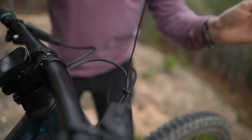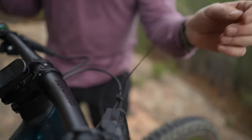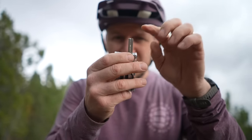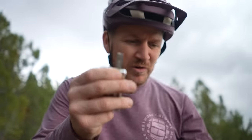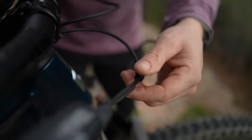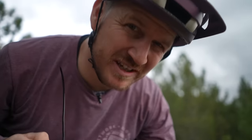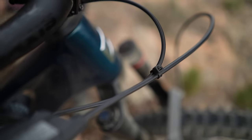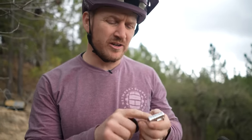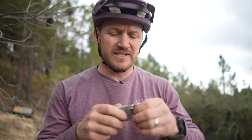But I don't like this bit right here — it's annoying. Most of us don't carry cutters or a knife on the trail, so I have a little hack. On your multi-tool you've got a five mil and a three mil — there's a tiny little gap in between the two. What you do is put your cable tie through that gap all the way, and then, whilst it's on there, just twist it, keep on twisting, and it will snap off just like that. When it snaps, it's actually twisted, so it's not giving you that nasty little sharp bit to cut yourself on. Neat little hack. An extra tip is multi-tool maintenance — these do come loose, and when they are loose this little hack won't work. Before you leave home, do a little bit of maintenance on your multi-tool. Give it a tighten up so it's all nice and stiff, because the stiffness is going to help you cut that cable tie out on the trail.